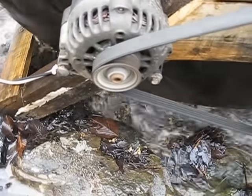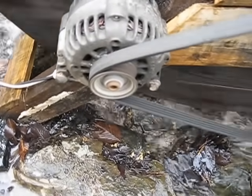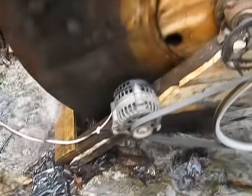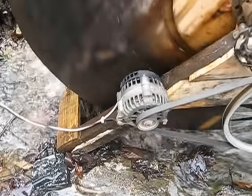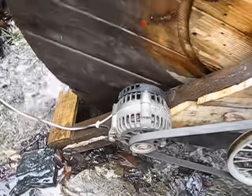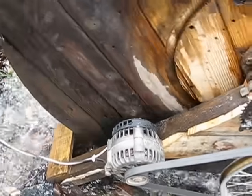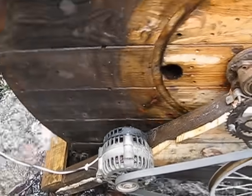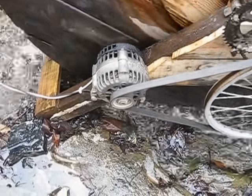This is not just a standard car alternator — well, it is a standard car alternator, it came off a Cavalier, but it has been converted. It's now a permanent magnet alternator. As you can see, there are only two wires: one going to the hot terminal and one to ground. There's nothing going to the field because there are no brushes in it anymore. I pulled out the rotor and I'll show how I did that later. I'm surprised at how well it works.